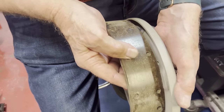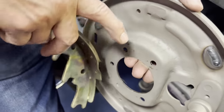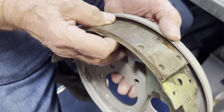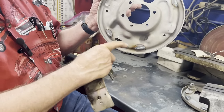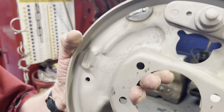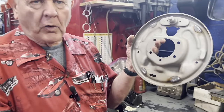You can see the back side where they actually rub, and if there's a little divot in here, when the brake shoe comes out it has a tendency not to go back to its resting spot, which makes the brakes drag. So we fix all of these — weld them, grind them back down, make them smooth, put some grease on them, and they'll work like a hundred percent.